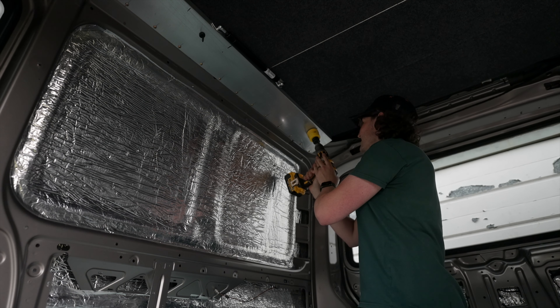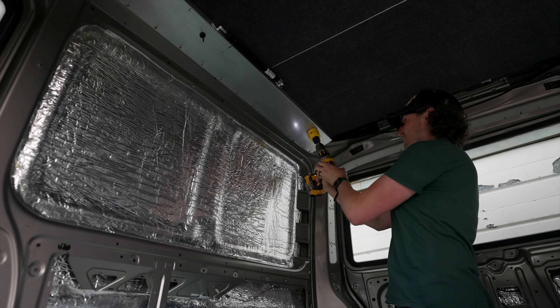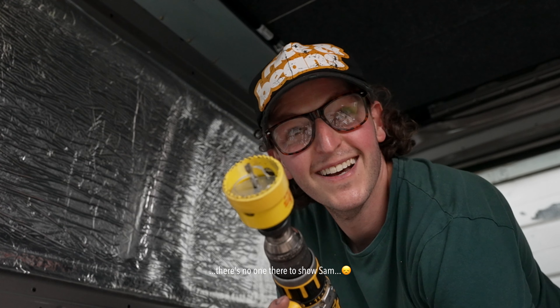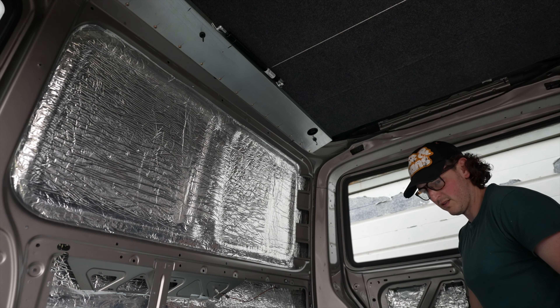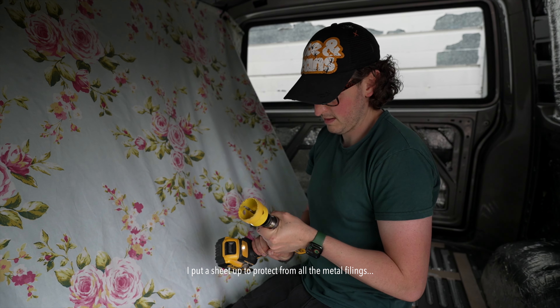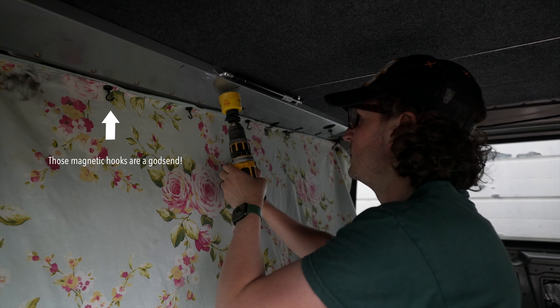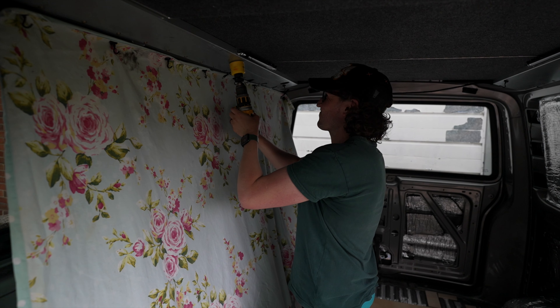So I drilled the pilot hole and cut the first hole. I wrapped the cutter with insulation tape to give me a stopper about a millimetre down — hopefully that works. I do not enjoy cutting metal. We're almost there... I did it. One hole cut out. I'm glad I put a sheet down because there's a lot of filings. I did not enjoy that.